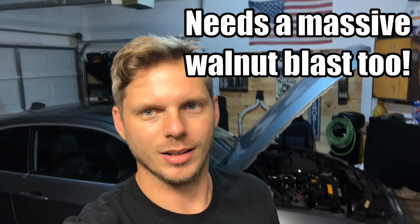As you saw when I started the car up, there's still a little bit of roughness. Again, it hasn't been running for a while, so it's difficult to determine, but we'll get the car situated. I've got to get the oil changed, and I think that's going to help. I think I am hearing a little bit of lifter tick, and that happens if the oil is bad, low quality, old, it needs to be changed, potentially thinned out by fuel. So we'll get some Liqui Moly in there, and that way we'll be able to eliminate all of the potential issues.